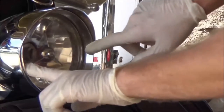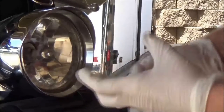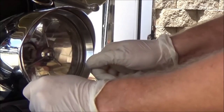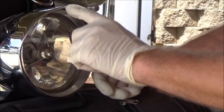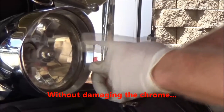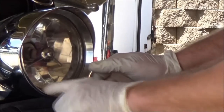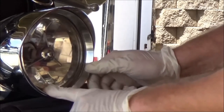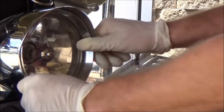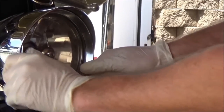First off, this bezel cover — it's a good idea on this one. I normally don't wear gloves but on this I am because I don't want to touch the bulb itself. This bezel cover is a lot of times siliconed in, which makes it very difficult to get off. I like to actually grease it. I use anti-seize to lubricate it, and I just know that this is a maintenance item that I need to go back and tighten up. I'm not a fan of the silicone, but do what you want.